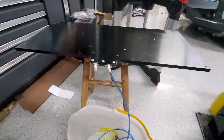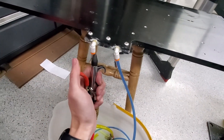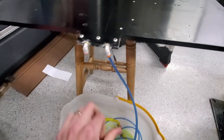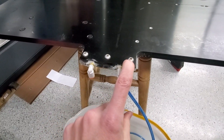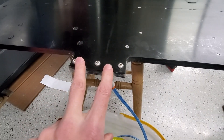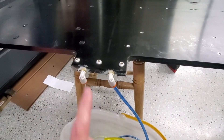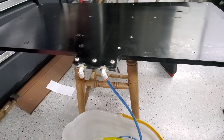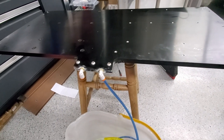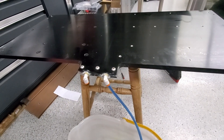Hey everybody, welcome back. This week we're going to finish up the cooling as much as we can and then get on to some electrical. Here's my rear cooling plate — I've got a little compressed air here, and that's where the leak is right there. These are new, so I think why it wasn't sealing before is essentially the last places I had tied down were here, so there was a lot of unsupported or uncompressed space. I'm going to take everything apart, add a new layer of silicone sealant, put it all together, test it again with compressed air, and if it still leaks we'll abandon this and go with something else.